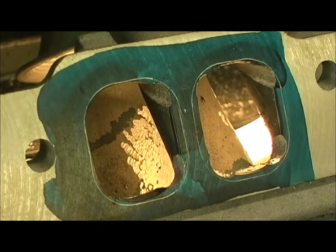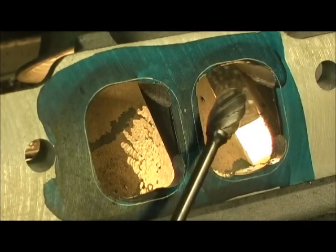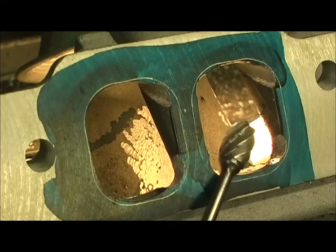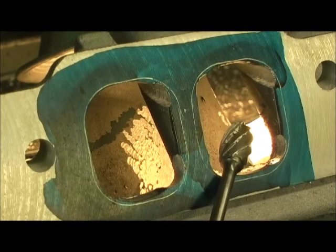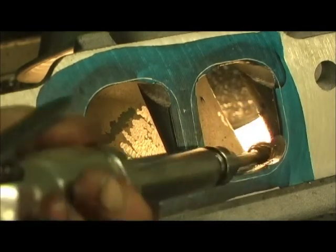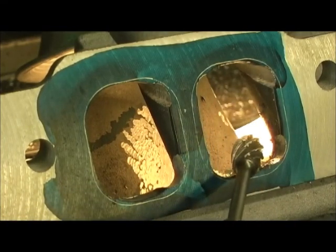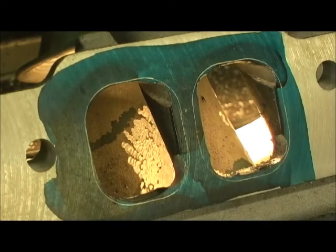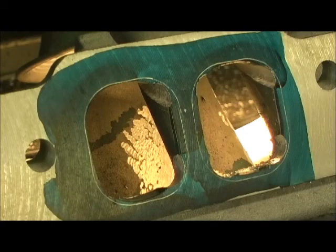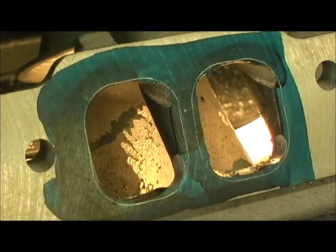In order to do this I've switched to my favorite butcher hog of the aluminum world — this is a nine-sixteenths or five-eighths egg, and this thing kicks ass like nobody's business. I've already trenched it with this. It's one of the few times that I'll trench and create the garden rows for raw material removal, to a point where I start switching to the smaller ones. I'm going to show you in steps as I cut, but the trench and the cloverleaf has already formed.